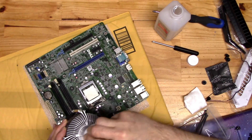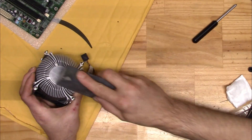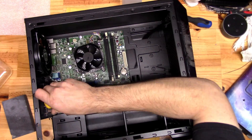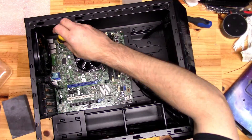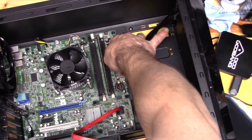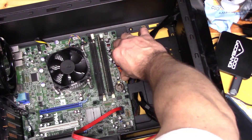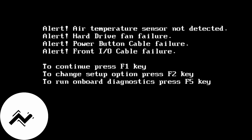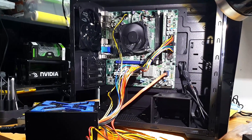What does this all mean? Well, it means we're going to run into the old dreaded 'Press F1 to continue' error, but we just might end up with something cool. For those who don't know, the F1 to continue error happens when the BIOS runs through its boot list and realizes not everything is attached to the board. As many people know, Dell is very proprietary in their PC parts — exclusive to their own systems only.